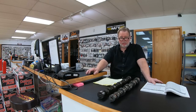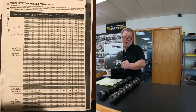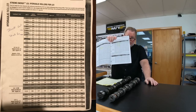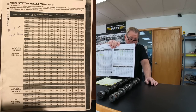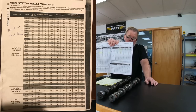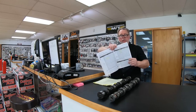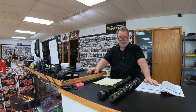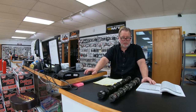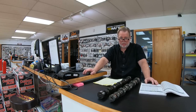One thing I want you to see is the difference between cam lobes, because that's really important. I'm referencing the Comp Cams engine builder book that has the lobes in it. The most important part is not the advertised duration, but the flow duration at 0.200" lift — which is when the valve is 0.200" off the seat. We'll put those numbers up so you can see the difference between different cam lobes, which you won't see in most places.